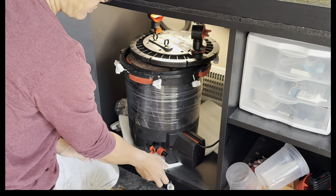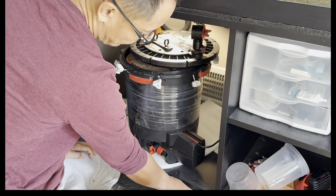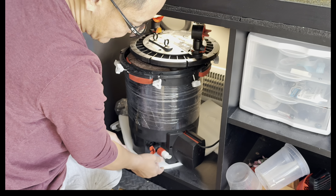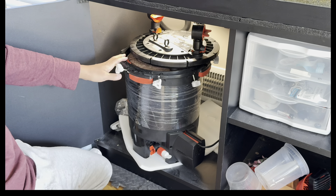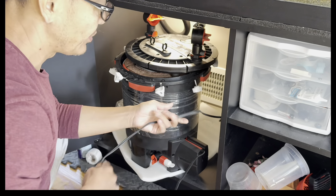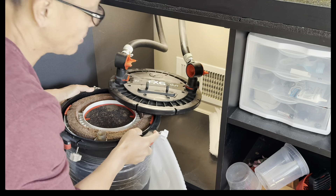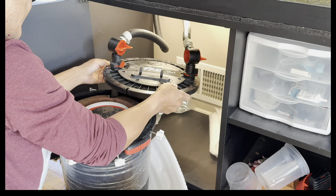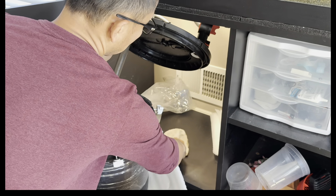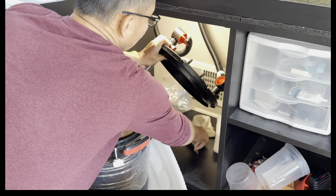With the drain done, I put the cap back on and make sure there's no more water coming out. I've seen reports where the valve connection here will start to leak — those kinds of things you never know about over the years, as plastic joints and rubber O-rings can weaken. It might be worthwhile to keep a couple of backup O-rings on hand. I should be able to pull the whole unit out now — let me get the power cord out of the way. I detach my hose completely and leave the vertical plastic tubing inside the cabinet.